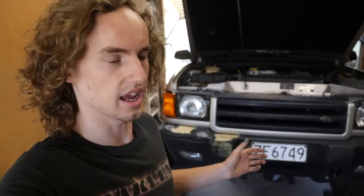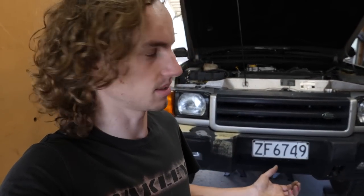So we've got the truck in the air and we've got the axle stands under the chassis. Super important that when you're doing this you put it under the chassis and not any of the suspension arms or the axles itself, as we're wanting to cycle the suspension.